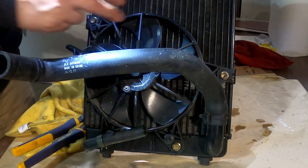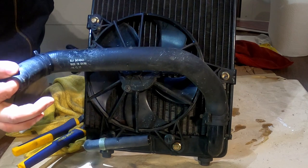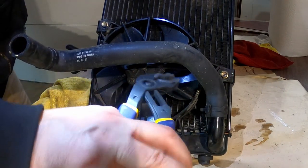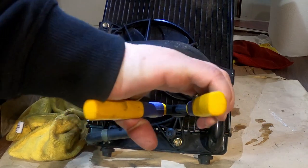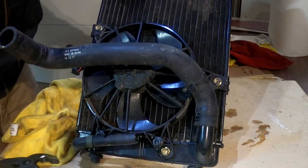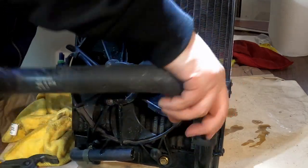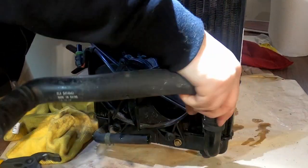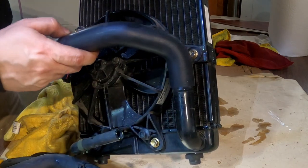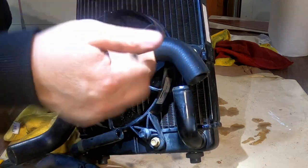Here is our radiator — this is the fan, this is that hose that connects around on the bottom, and this is the one that comes all the way across and it has the rip right here. This is the new one they sent me. The best way to get these off is with pliers that you can open to the right amount — squeeze them really tight then wiggle them back and forth until they're completely off the metal, because the metal has a little lip in it. Twist it around and then start lifting. Make sure the clip is on the other side of that lip, because even with expansion it won't slide off — that little lip is what prevents it.